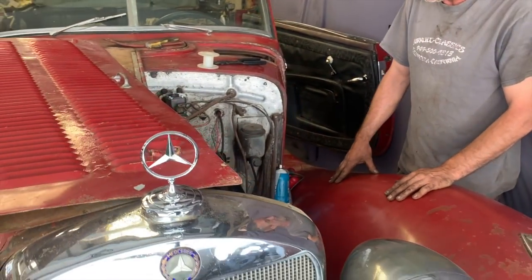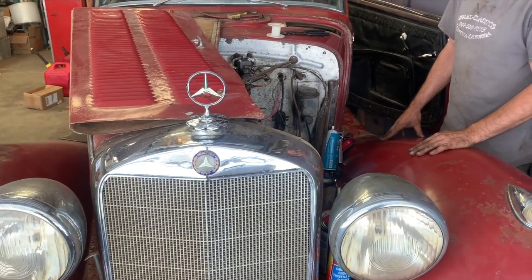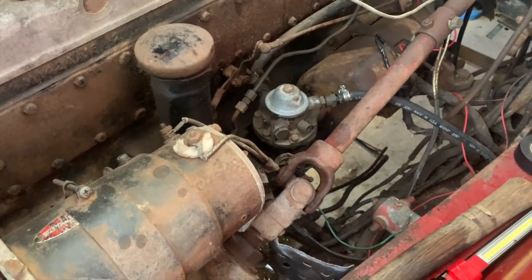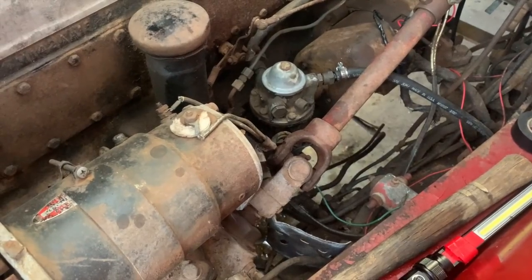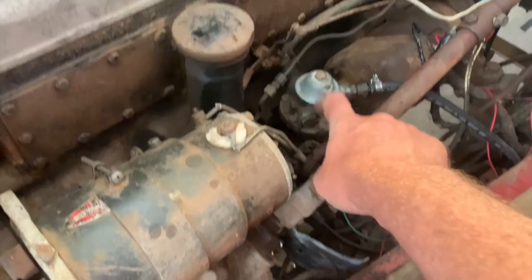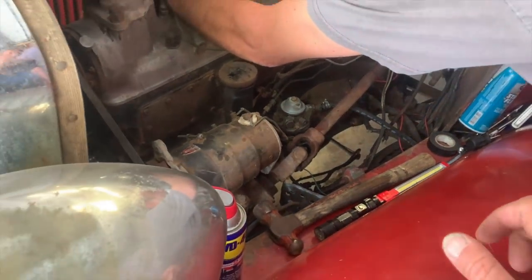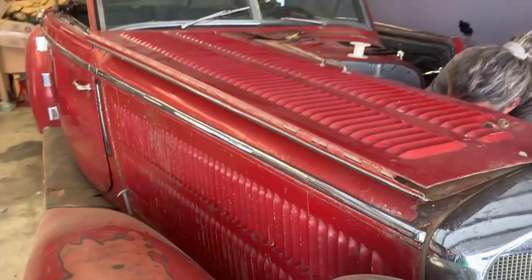Well, I mean, we could do that, or we could try to open up that pump and see if we could do something with it. You know, I'm looking at it, it looks about the size of a 36 horse VW. Oh, for the diaphragm. It's pretty damn close. Point it out to me, Randy. This is the fuel pump right here. Oh, okay. And there's a diaphragm in there that pumps up and down that kind of pulls the gas through there. And those things get old and brittle. We haven't messed with it at all, and it could be that it's just junk.